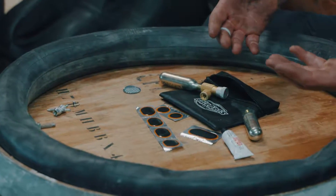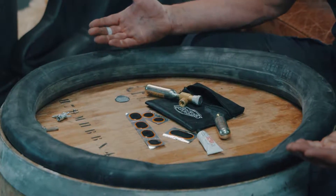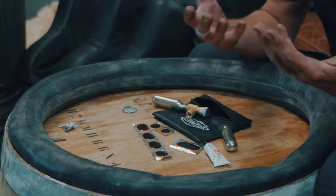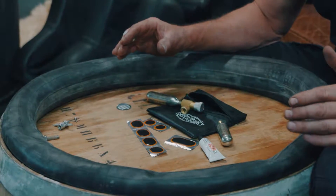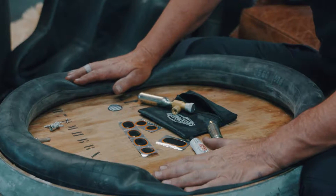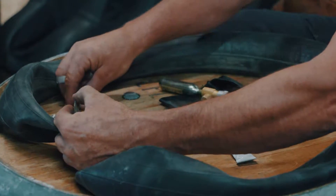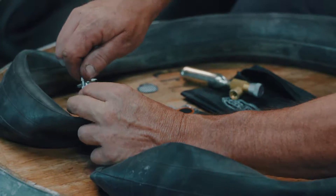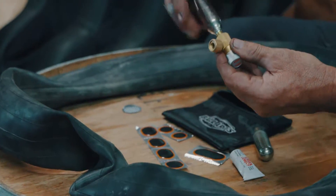While that's drying you get everything else ready, then feed the tube back into the tyre. So now we've got the demo of actually using the CO2s in the tyre repair kit. Whether you're using a spare 21 inch lightweight tube or you've just patched it, the general thing is you'll have the valve removed. If it's wound up and compressed into your bum bag, you put some air into it — it lessens the chance of pinching the tube when installing. Blow into it to get it into its neutral state, push on either side in one area, and that's about how much pressure you want.